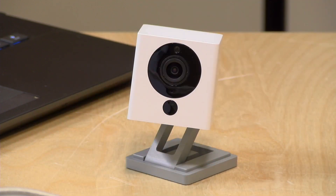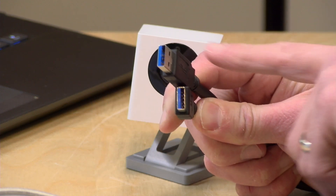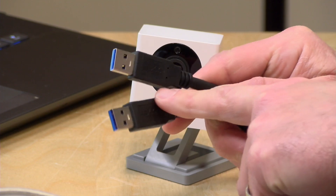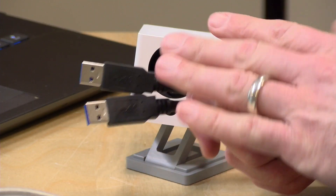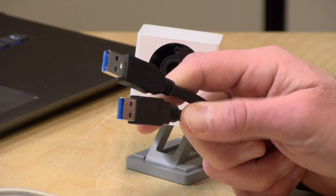You also need a USB cable — specifically a USB-A to USB-A cable. These are not that expensive but you likely don't have one lying around. If you do, you're ready to go. The cool thing about using this cable is that you don't need a separate power source; your computer will power the camera. A USB-C to USB-A cable did not work for me, so you'll definitely want the USB-A to A cable. It will work with both Mac and Windows, but this cable is the only way to get it done.